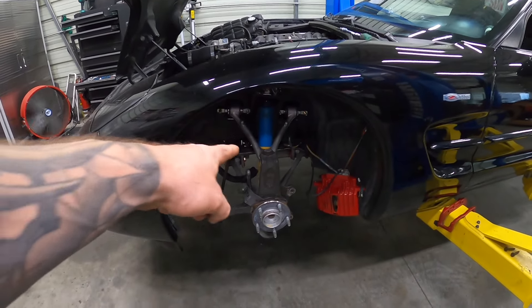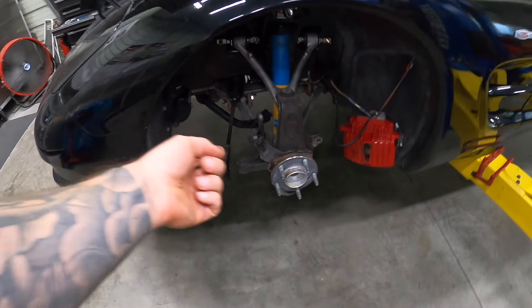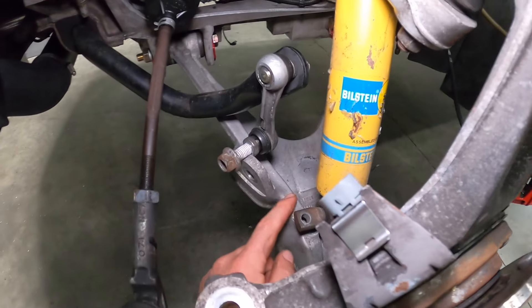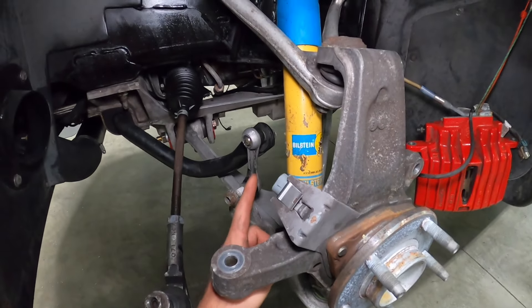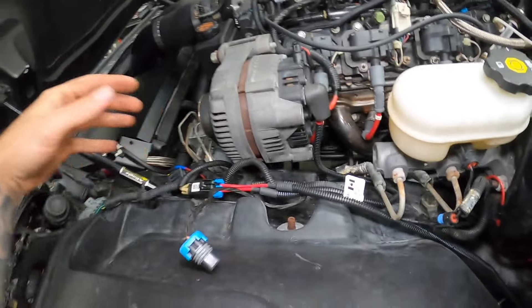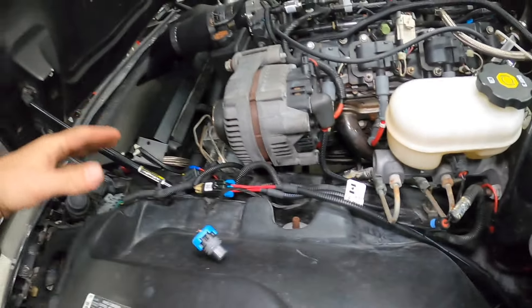As far as the leaf removal — I'm sure if you guys are tackling this you can figure it out, but it's very simple. It's the bolt that goes straight through the bottom of the control arm. You can see there's going to be a little C-clip and then the nut — hold that and remove it. Once you do that, the monoleaf is going to retract. Then you just take off these four 13mm bolts and take the leaf out. Pretty straightforward.